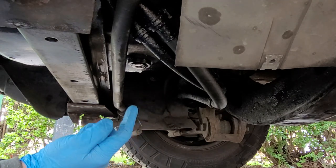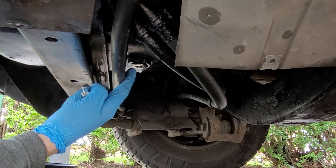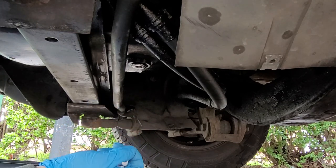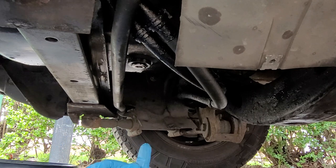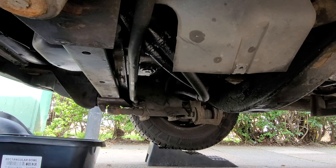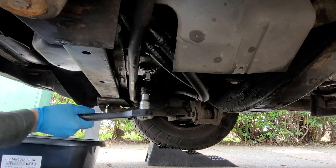That's the sump plug that's got to come off, and it's just reminded me — there's a tiny little leak coming from that sump plug because the last three oil changes I've not replaced the washer or the sump plug, which is advisable. The constant compression of undoing and redoing it means trying to reseat an old washer just isn't doing the job. I'm not going out again — the nearest motor factors is about six miles away. Now I've got the wrong size socket — it's an 8mm I needed, not a 12mm.